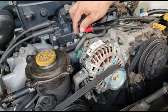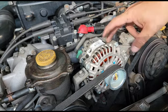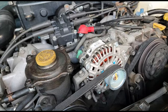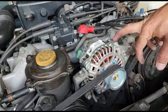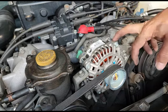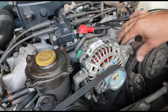I ended up having to replace my alternator. I went to the junkyard and found this one right here — still has the sticker on it. I Googled the part number and this is a 90-amp alternator. The one that came with the car from 2000 is a 75-amp, so this is an upgrade. I've got an amplified system on my car — not a very big one, just drives my subwoofers — but every little bit helps.